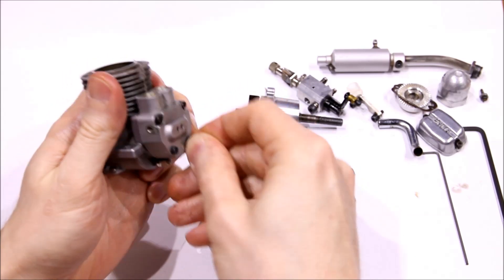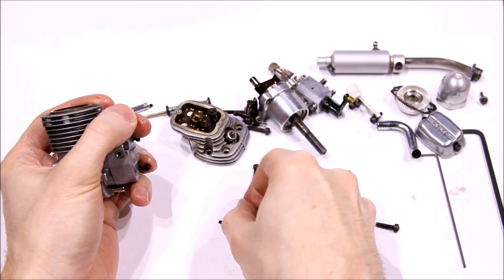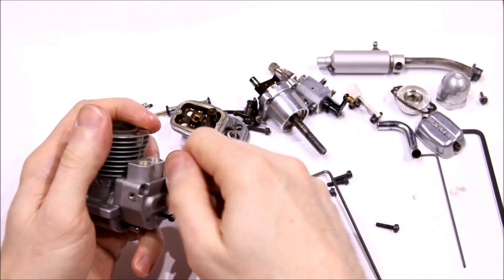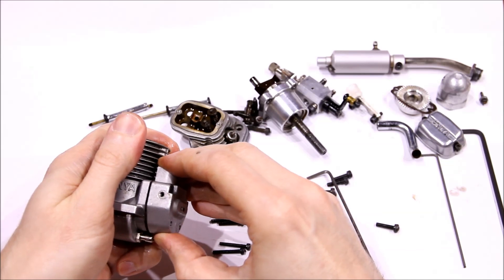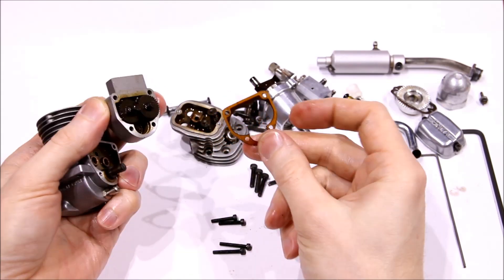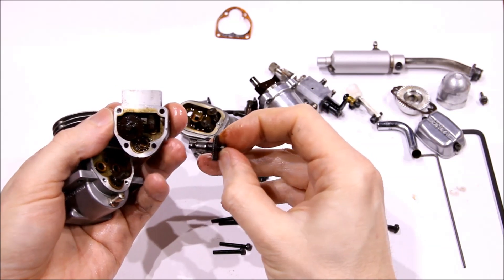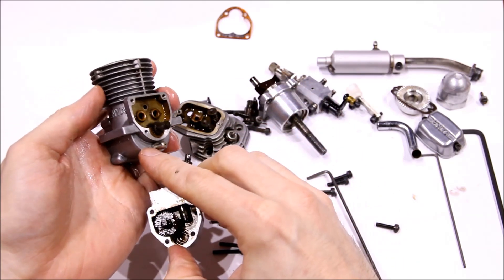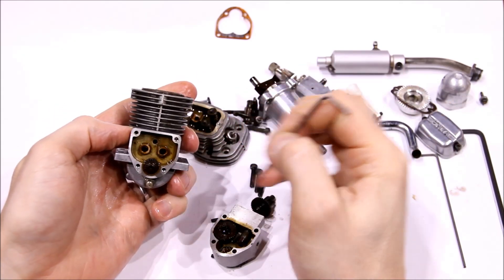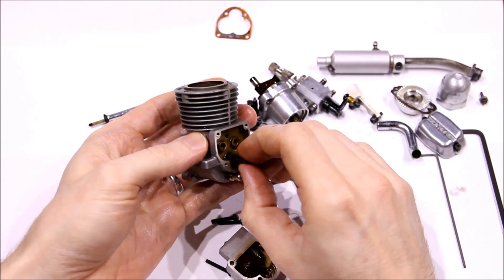Pull the cam box off next. There are two different sizes and lengths of screws holding the cam box — the upper screws are shorter than the lower screws. That's important when you're putting it back together, so pay attention to that. There's a gasket on the cam box that should be there. The dirt in the cam box is pretty typical of Enya engines — there's not a lot of flow through there, so the oil and grime builds up. The vent is in the bottom of the crankcase, so the only way for the cam box to breathe is through the hole on top, and dirt and oxidation is very common.